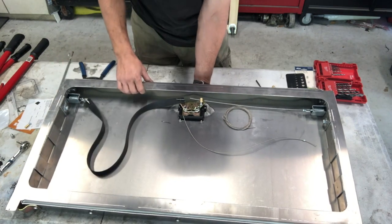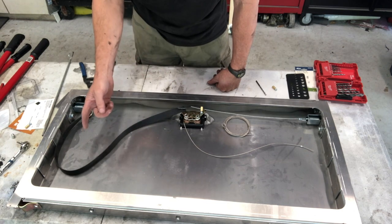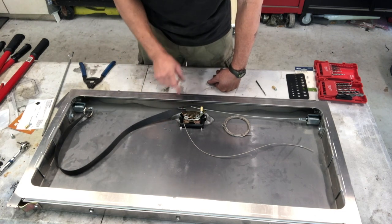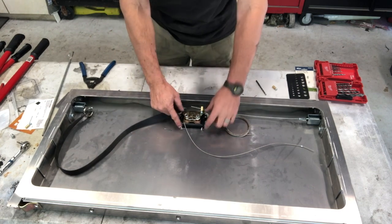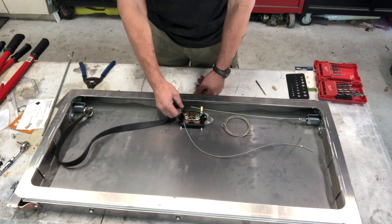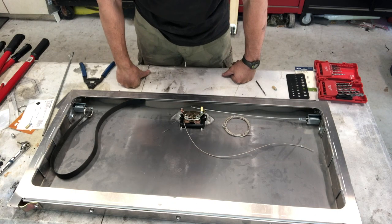Good thing about the biothane strip is you already have it. It's pretty tough stuff. It's not going to get any UV degradation inside the tailgate. It's not going to corrode. And that's a pretty simple connection to make. If it does break or for whatever reason you need to take this apart, I bet you could take those 4 bolts out, pull that latch out to the front, and be able to work in here and pull that pin off, and then your latch can come out. Then you can pull the side latches out, whichever way you need.